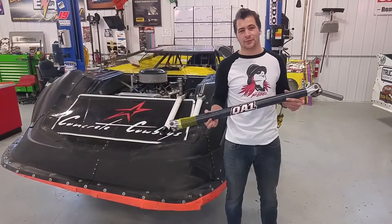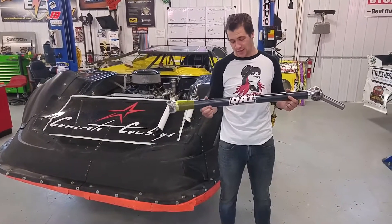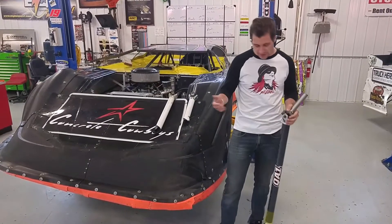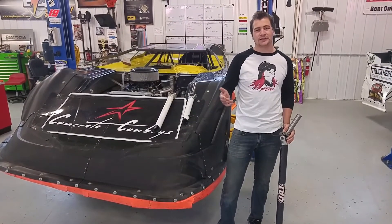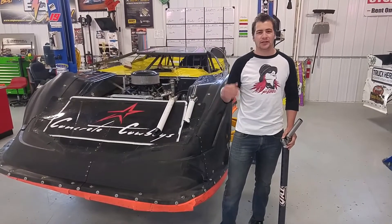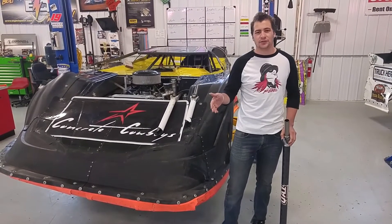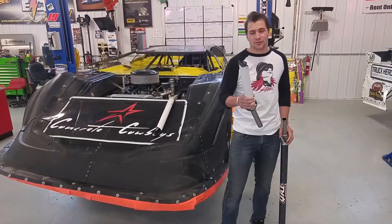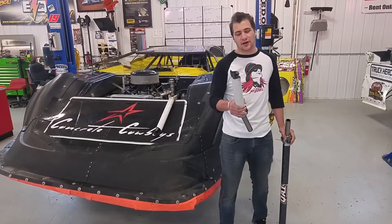There's really only one reason to buy a carbon fiber drive shaft and that is because they are so safe — safer than a steel drive shaft. If your drive shaft breaks while you're racing, you end up with a steel drive shaft whipping around there. It can enter your cockpit and it can screw up the X tubing on your frame. But with carbon fiber, it'll just disintegrate, which keeps your driver safer and your car from more damage.